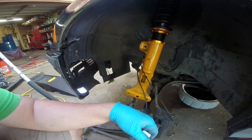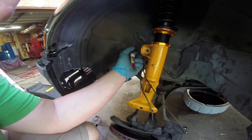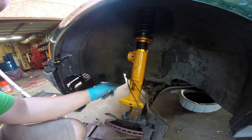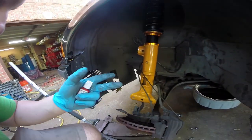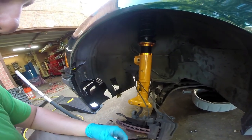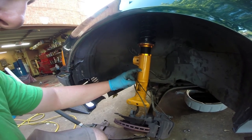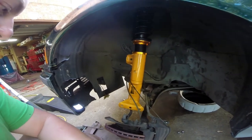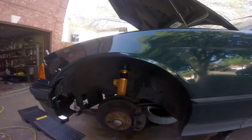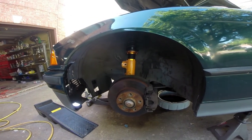One very important thing — everything that goes back in down here has got to have Loctite. We'll put all the rubber grommets back where they're supposed to be. On some cars like the M3, this bracket is used to mount the sway bar, but on this car the sway bar mounts down to the control arm, so it's a different design. We're not going to use that bracket, but it is there for those who need it.